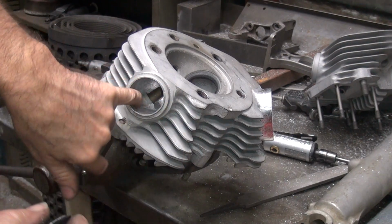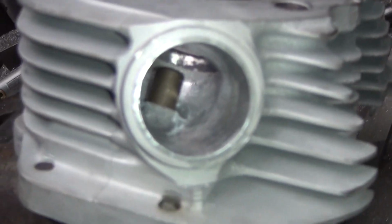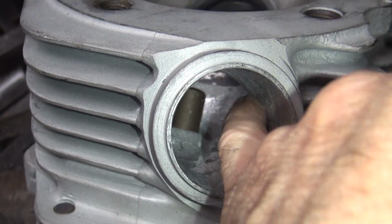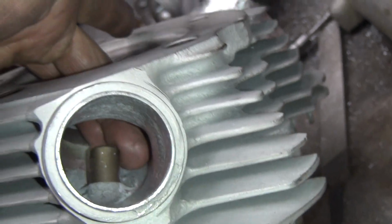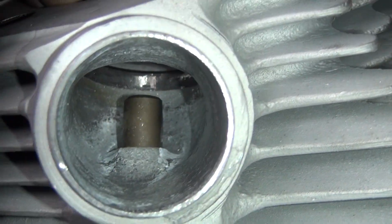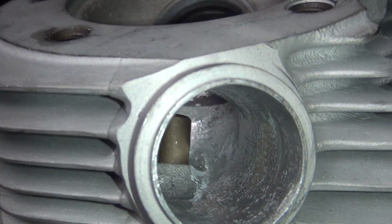About it. Feels good there. You see a lot of low spots in there, but it's okay. The high spots, the smooth spots are good. There's no high spots, so you can see all the little dimples in there all the way through it. That's pretty smooth all the way in, and the shape's good. Airflow goes right through there. So see how it's kind of equal to this side? Slightly different, but close. So you look down, you got two fingers of airflow coming through. See? Right on through it.